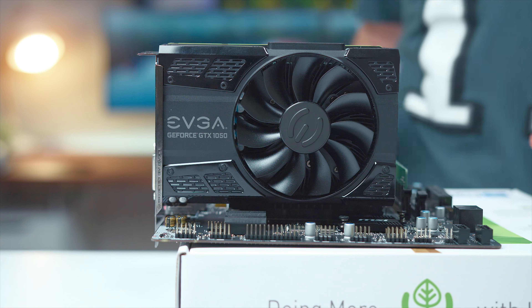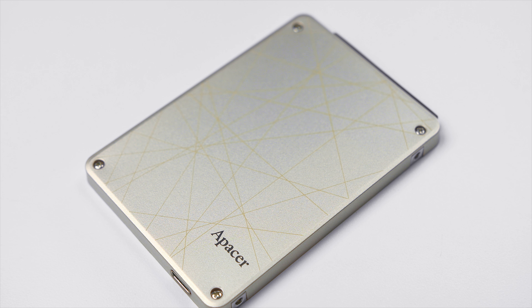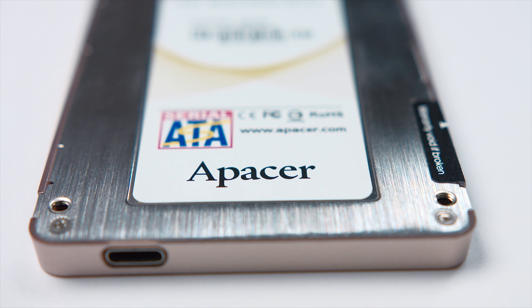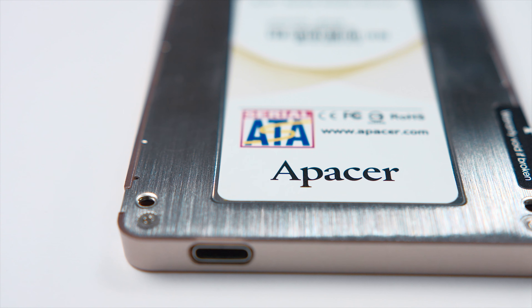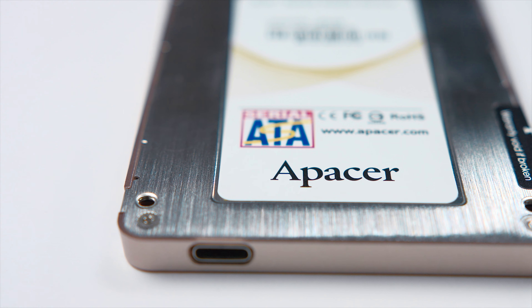Then to finish off the PC, go with either the 430 or 500 watt power supply from EVGA — they're both $35. I'll list them both down below. I'm using the 430 watt version. EVGA is highly reputable, and either option is gonna be more than enough power to fuel this build. You can see with this case our PSU is gonna be top mounted. Then lastly for storage, you'll have the option: if you want more space for more games, pick up a one terabyte Seagate hard drive for like $45. But if you value blazing speeds or are gonna be installing a handful of games, go with an SSD — you can get 120 gigs for under $50. I'm using an SSD for this.